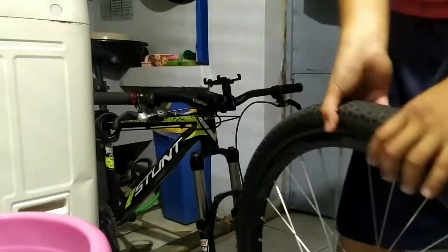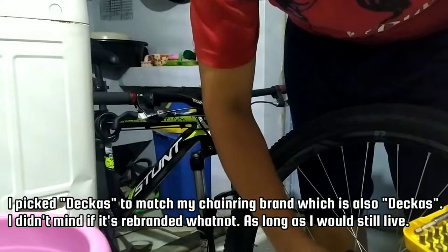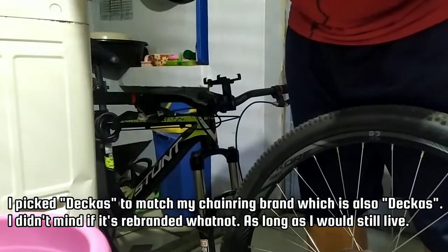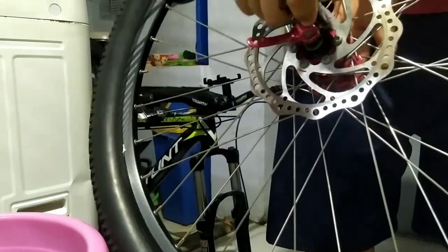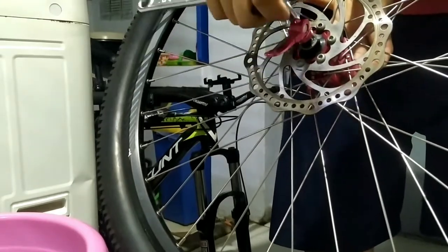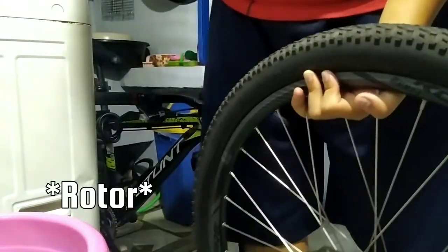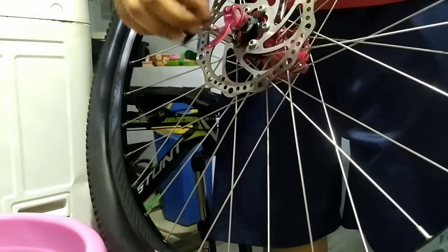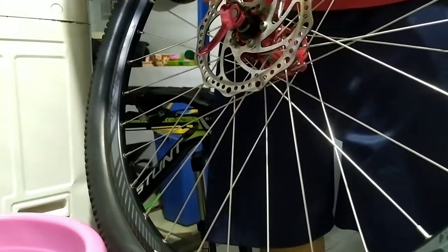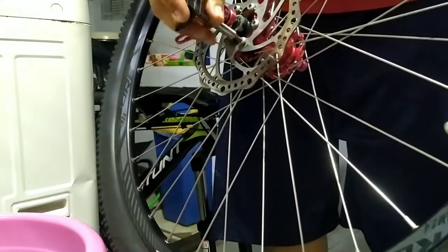The reason why I picked floating rotors and especially chose Dekas is that the brake caliper I'm using is a hydraulic brake caliper that is cable-actuated, and the brake pads that came with it don't support any fins at all. So with this floating rotor, I was hoping for better heat dissipation, so that the hydraulic mineral oil within the caliper will not boil and lose power.